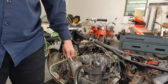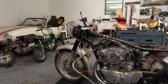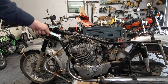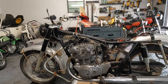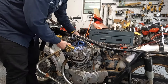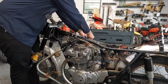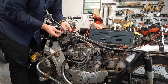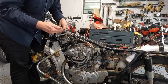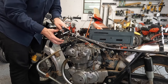I'm going to pull off this top motor mount, then we're going to do this bottom one, then it's on to the exhaust pegs and things like that. We should be free after that. We'll do the exhaust front mounts — I can't pull off all the mounts until I take off the exhaust. Let's start with this mount and go from there. I like to put my hardware back together the way it goes — nuts and bolts back in — so I don't have to worry about it.